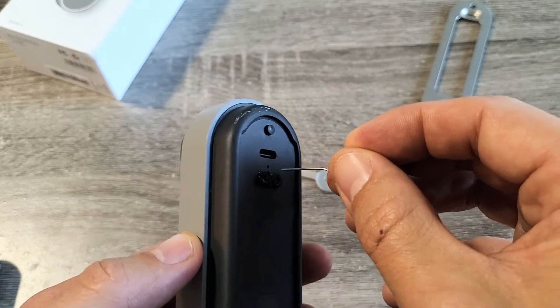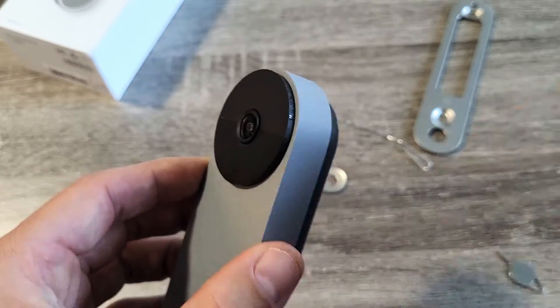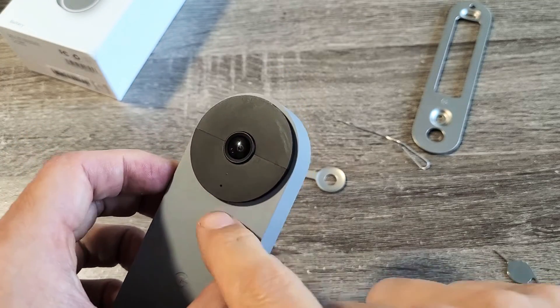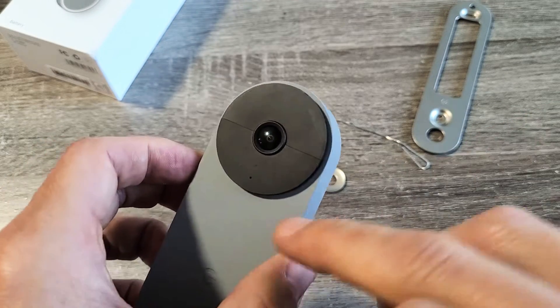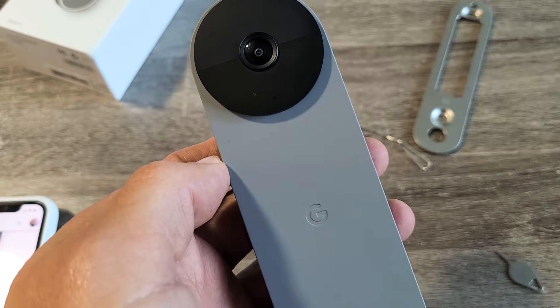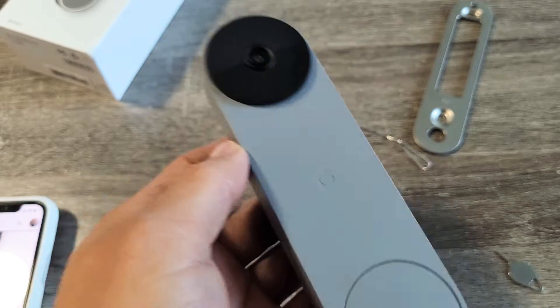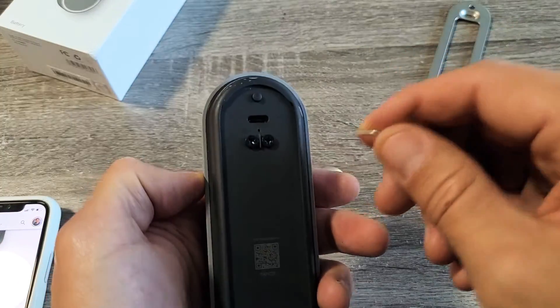What we're going to do is press and hold for about 12 seconds. We're going to see a yellow flashing light about four times, and then eventually it's going to go ahead and stay a solid yellow. It'll stay solid yellow as it's completing the factory reset. At the end we'll hear some kind of confirmation tone — actually we'll hear two confirmation tones.